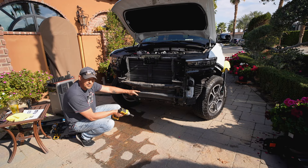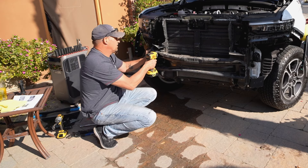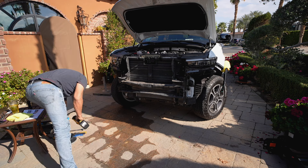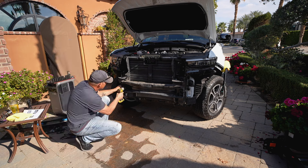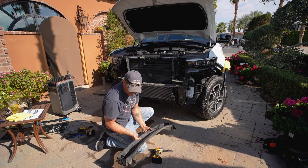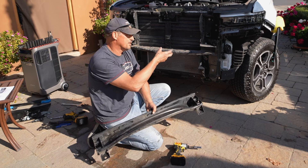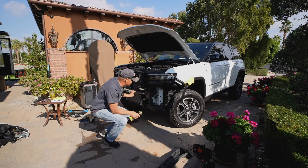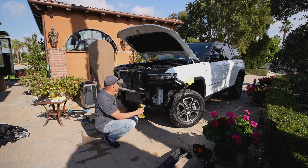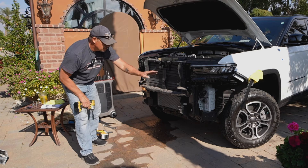So now we're going to take the bumper off — this is ultimately where the base plate is going to sit. It actually replaces the front bumper on the Jeep. It's held on by these four bolts, and then there are two really small 10 millimeter bolts holding it on as well. Now we've got the front bumper off — this is the only piece we take off that we don't put back on. We also need to pull the horn off both the driver's side and passenger side, and there's also a pedestrian alert system here — just a couple of 10 millimeter bolts, so we'll pull all that off really quick.